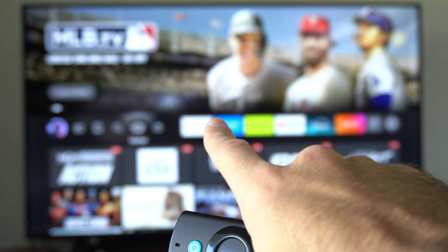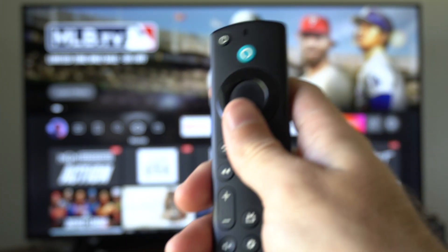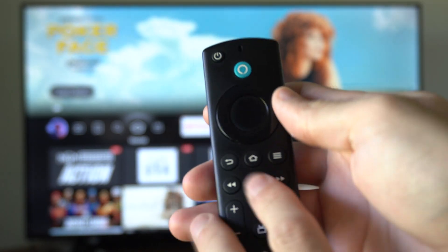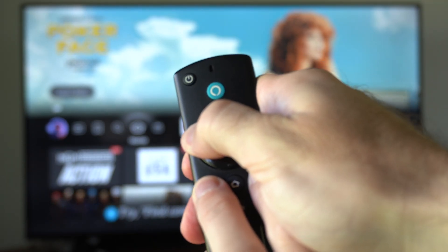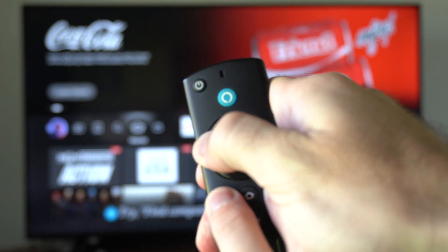The first thing is to go over to your TV and unplug your TV and your Amazon Fire Stick. Then go over to your remote and hold down the back button, the button with the three lines on it, and the left button all at the same time and hold this down for 15 seconds. You can count it out loud, but at 15 seconds your remote will reset.